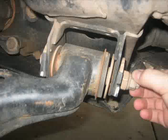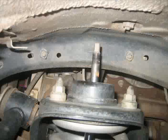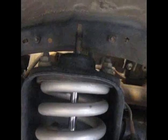I attempted this process without loosening these two bolts and found that the lower control arm will not drop as far as I needed. Next, you can remove the top nut, washer, and bushing connecting the top plate to the coil-over assembly. The shock absorber has positive pressure, so the shaft will not slide down. It will stay up inside the top plate.